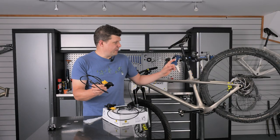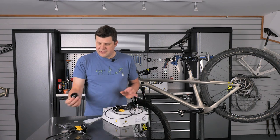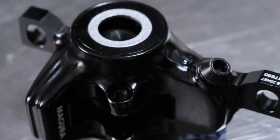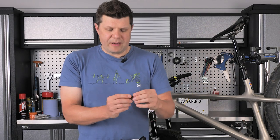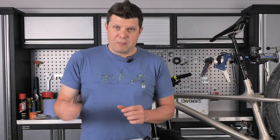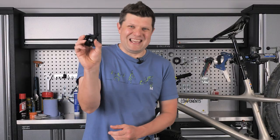This caliper is exactly the same as you'll find on the MT7s and MT5s — it gives you loads and loads of braking power. On the rear you have a simple two-pot caliper, which is actually a nice lightweight set, the same one used on their cross-country brakes. The pad size gives you a pretty large contact area, so it's still significantly more powerful than some sets from Shimano or SRAM. What was happening is people were buying this set and then removing the rear caliper and buying an aftermarket four-pot — so we've done that swap so many times that we now have tons of the two-pots in the shop.